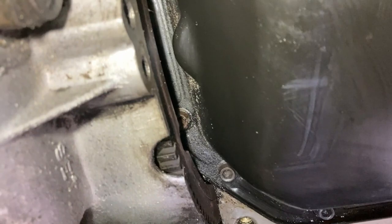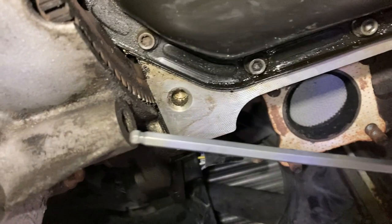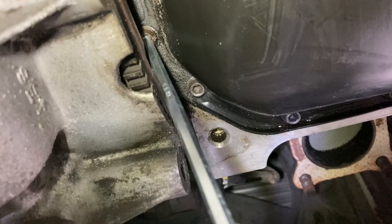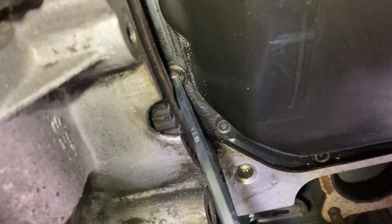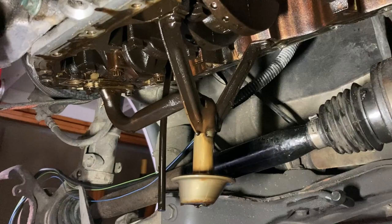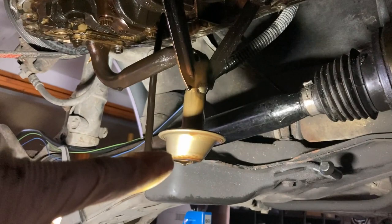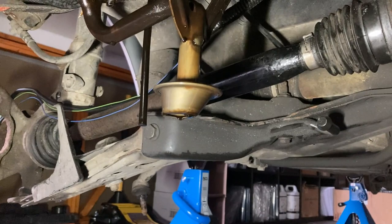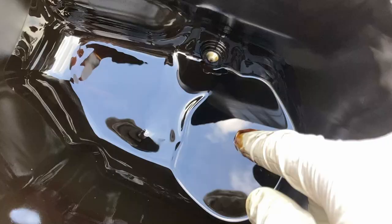I got the tool fitted here — it's a normal T-shape allen key but with a long shaft. Now I can fit it. The big question is how am I planning to reach the required torque here. We'll see later, but now it works. This is how the inside looks — I was a bit scared I'd find mustard-like deposits where the suction hose is, but no — not the case. Now I need to remove that one to get access to the oil pump and I'm going to check the bottom of the oil pump.